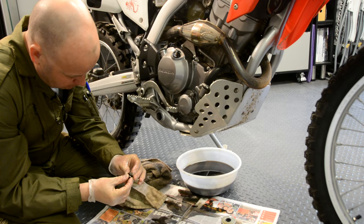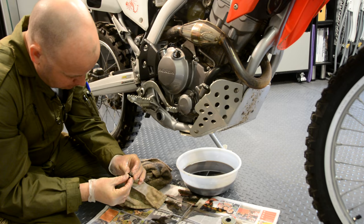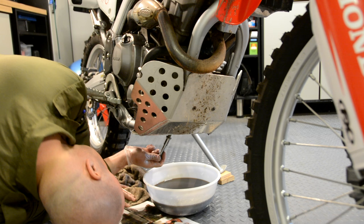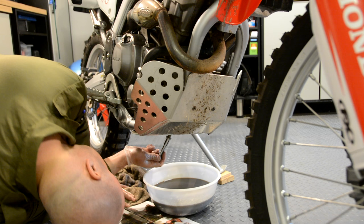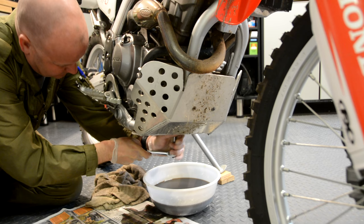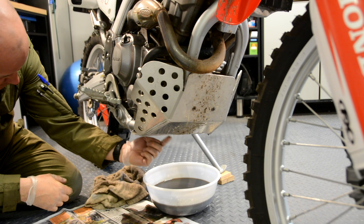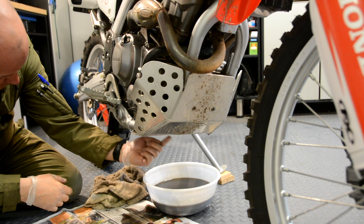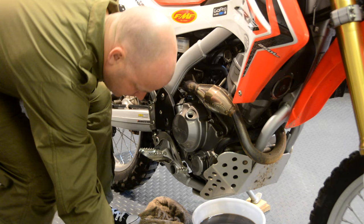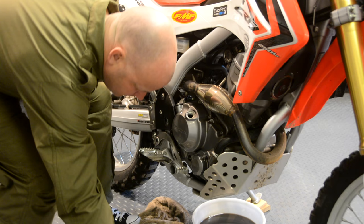Next is the drain plug underneath. We've got to remember to put the washer back on — if you've managed to keep it and it's in good order. These don't go on very tight at all, as you may have noticed when I took it off — it's basically just hand tight. Just find the hole and hand-tighten it for now, then just that much and no more. There's still a little bit more oil dripping caught on the bash plate unfortunately, so I'll need to clean that up afterwards with the rag.